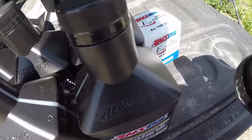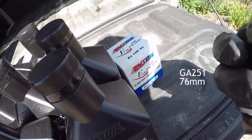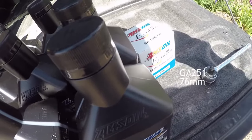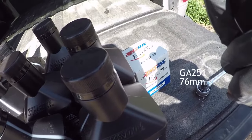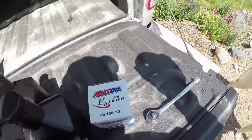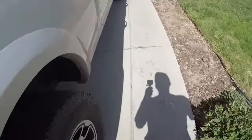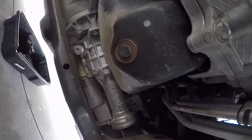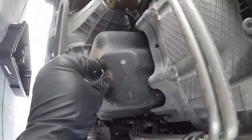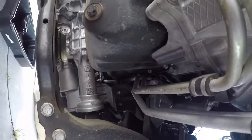For the oil filter, I use the AMSOIL filter wrenches. This is the 425T — this is the one that will work on the 15K50 oil filter. This is the first time I've done the RAM oil filter change and it's under here. The drain plug is pretty simple and straightforward. Looks to be a half inch right there. We'll get that popped off here in a second and draining.